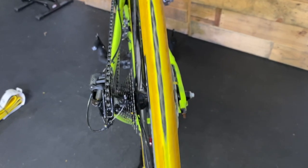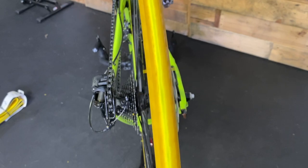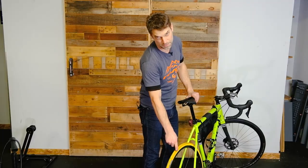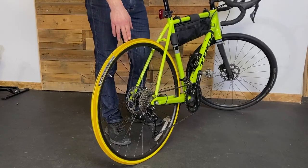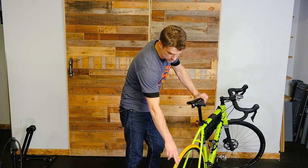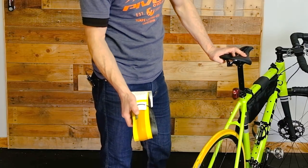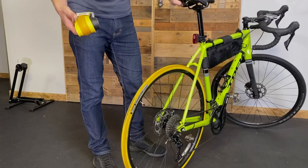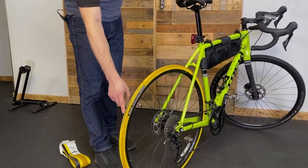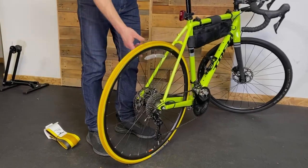The person who's been riding this bike has totally blown through the tire. This is a trainer tire, which has a much higher durometer rubber than an outdoor tire — these are made to last a long time on the indoor spin bikes. You never want to ride these tires outdoors if you have one of these colored tires made for indoor use. They are too hard to ride safely outdoors — it'd be quite slippery. What we see here is this tire is completely done.